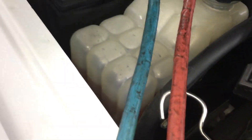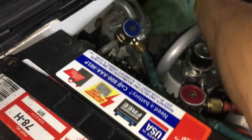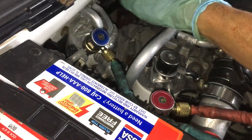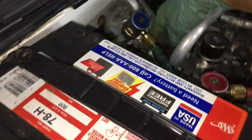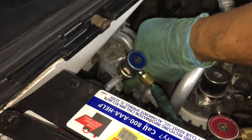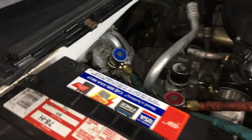Now I'm fighting getting the refrigerant out of the accumulator — this is all I'm waiting for. That's going to be the longest process. This line is cold because it's attached to the metal accumulator, and this is insulation. Even though everything out here is really hot from the engine, this is chilling down to ice. There should be condensation on there — oh no, it's ice. It's below 32 degrees. That shininess is not shiny metal, that's actually ice. It has frost forming on it. It's below freezing inside this unit. That causes problems. These are hard to pull refrigerant out of.